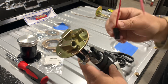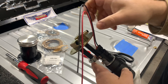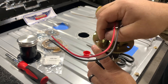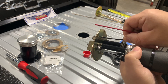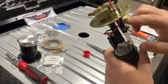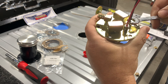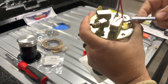Moving on to the electric connection — it's kind of idiot-proof. It only goes in one way; you can see where the clip is. But before we snap that in, they give you these through-bulkhead fittings where you're going to slip the wire through and then tighten down on these little ferrules or compression nuts that will hold the wire securely in place and not allow any leaks. I've got these all the way pulled through but I want to leave just a little bit of slack — I don't want to put strain on these wires. Now we're going to tighten down on these nuts; I'm not going to go gorilla tight, just snug.